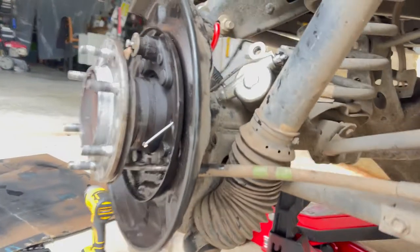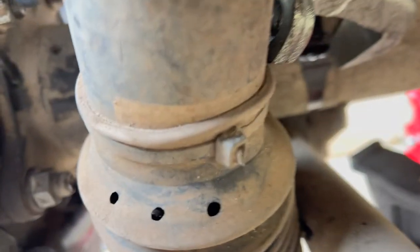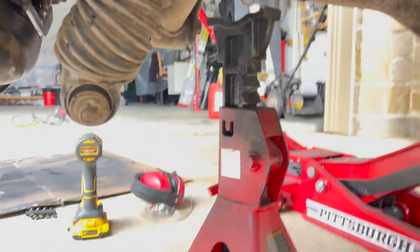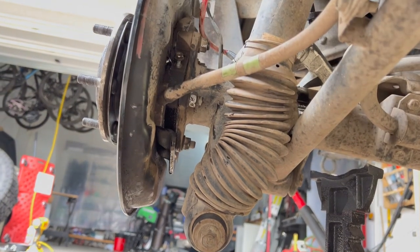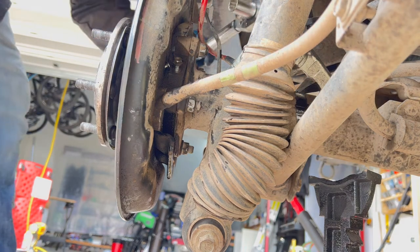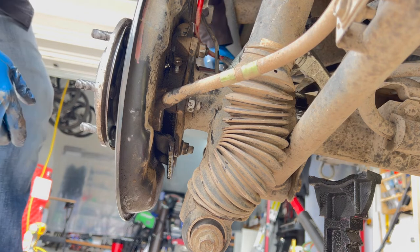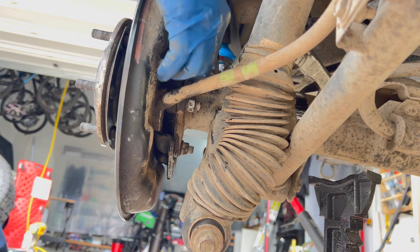Be back. Okay, we got these little parking brake retainer bolts in, and I've got the backing plate nuts snugged up consistently. And so now I've always had this issue. If I can't get a torque wrench in there, how do I figure out what torque value I'm at? So I'm thinking what I'm going to do here is, well, I think I've got them all at pretty much the same torque consistency. So I've got my torque wrench set to 91. So I'm going to push it around and see how far it turns. And let's say it goes an extra quarter turn or whatever. Well, in the areas I can't get the torque wrench in, I'm going to do that with the wrench. So let's try that.